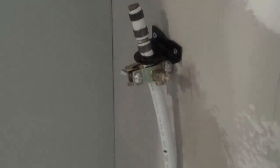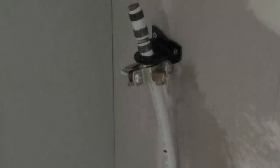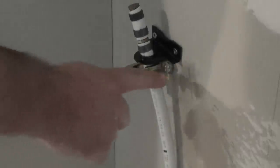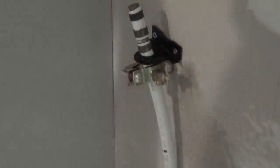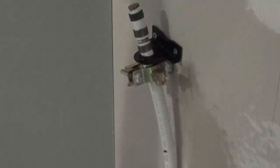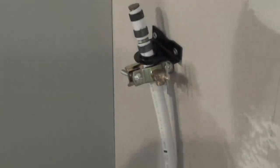Now I'm going to clean up a little bit down here and then connect the water line. I don't need all 25 feet so I'll leave about 10 feet so I have enough room to bring the fridge out. I'll connect this side first only, then open that valve and run it for a while — run the water into my sink to rinse and clean out all the dust and manufacturing debris that might be inside that line. I'll try to do the same with the fridge lines as well.